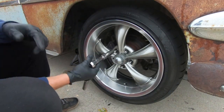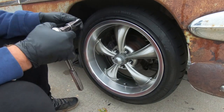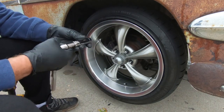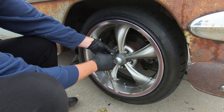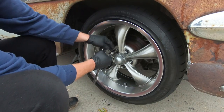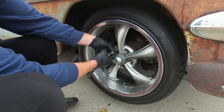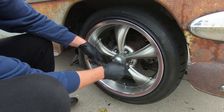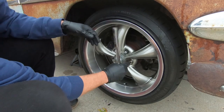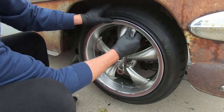You might've noticed that I couldn't get my 17 in here, so I've got some cheap deep sockets and I'm having to run it down with that just because there's not enough room to get your impact socket in there — which is pretty common. I've had this before. You could get some different lug nuts, but these lug nuts look pretty decent and they fit, so we're going to use those for now.